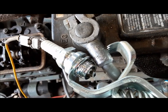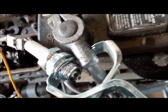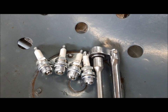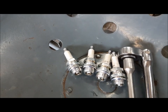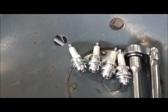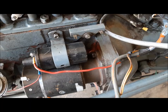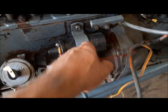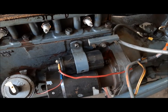All four of our new plugs are properly gapped to 25 thousandths, and as you can see, they all work as they should. I have no idea what happened to make all those other ones go bad. Sometimes spark plugs, if you drop them on the floor, that'll wreck the insides of them, or sometimes they can just be bad out of the package. Out of seven spark plugs to have four bad ones — that was really weird. Anyway, these ones are all good. We're going to go ahead and put them back in the engine. Another thing I don't like is how the ignition resistor has been bypassed — I'll show how to figure that out once I know the thing runs.